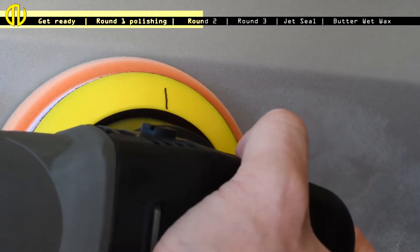I went ahead and gave it one last try. Attempt number 3 — I could still see a slight marking. Sure, it got better and it's not as noticeable, but since the scratch is too deep in the clear coat, I could still see it. This is where I stopped. Sure, there are different stronger cutting compounds out there, but there's a point where we need to start worrying about removing the clear coat completely.